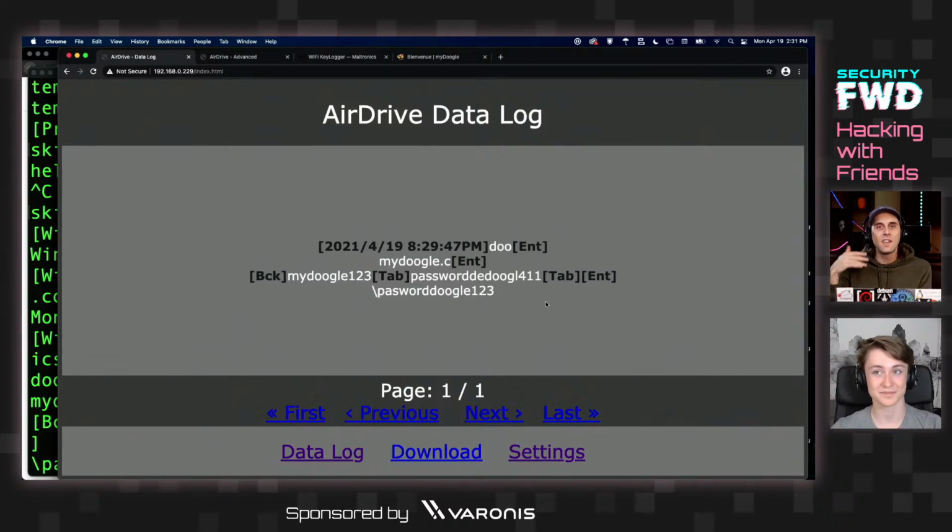So like in the access point mode, this thing will not allow you to use the internet because your computer is directly connected to this. So, I mean, you can have two wireless cards. Like, there's other ways you can potentially get around this. But really, there is a disadvantage here if we're just going to leave this to access point mode. So, James said it best, we can't use the internet, and that would be really annoying if we maybe forget a command and need to look it up. Guess what? You got to disconnect, look it up, and then come back, which is truly irritating.